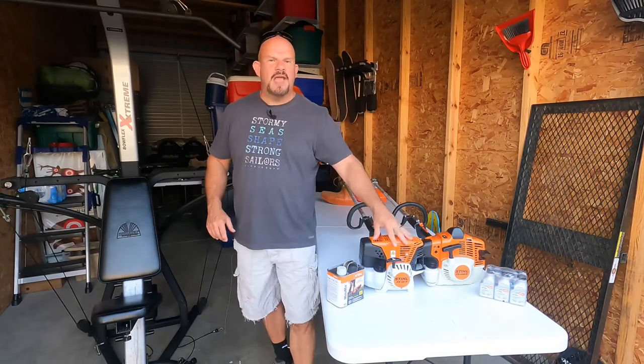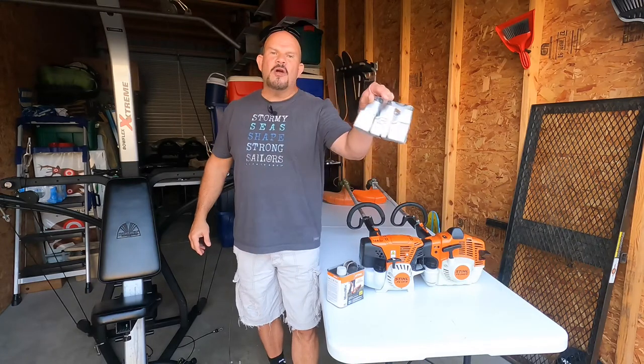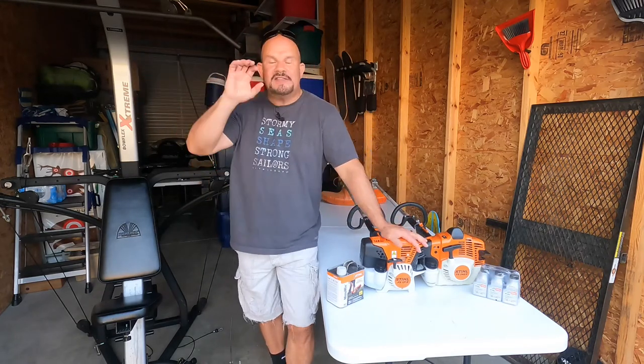Here's what 99% of the time is taking place with your STIHL power equipment. Let me tell you what's normally wrong with any STIHL equipment that's been abused: they've used old fuel, crappy fuel, ethanol fuel, leftover fuel, or they've used some generic brand of oil to mix it. Over time, over the seasons, over the winter, it's gunked up that piston and the valves.